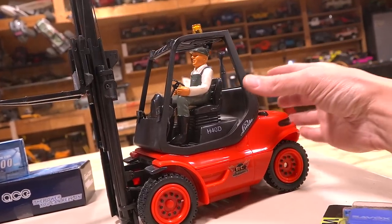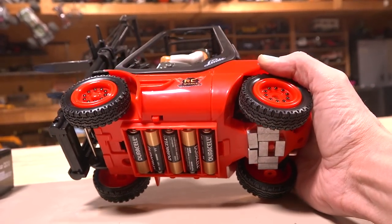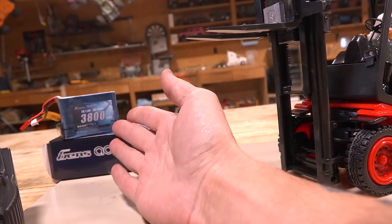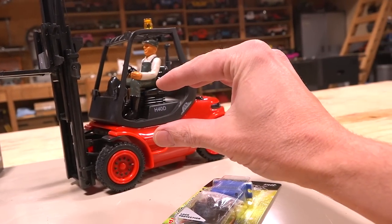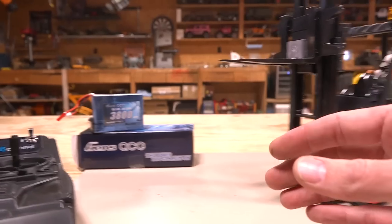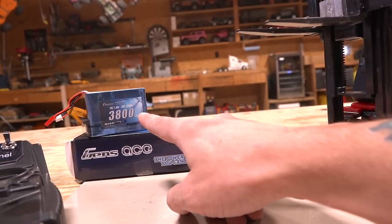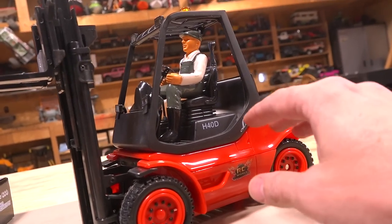This little machine is like toy grade — sold as a toy overseas from what I understand. If you check the bottom, it takes five double-A batteries at 1.5 volts each, which means 7.5 volts altogether. This LiPo is 7.4 volts and gives a constant voltage discharge. AA batteries are awesome and run a long time, but as they run they start to lose power — like a flashlight that starts bright then fades. A LiPo battery actually gives you constant power all the time until it's done.